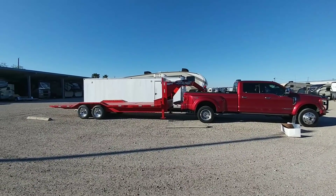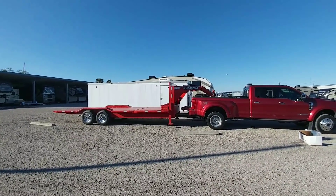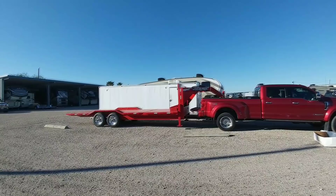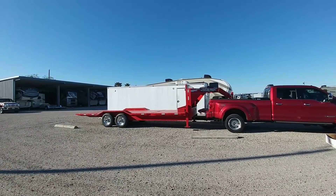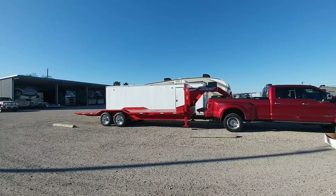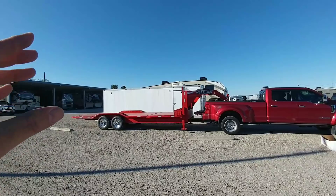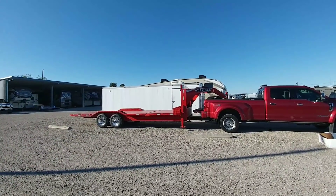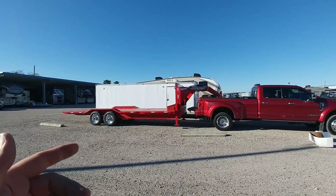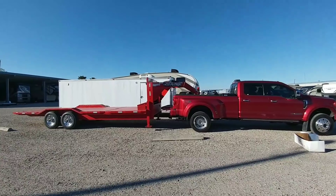We have some videos coming up, so subscribe if you haven't had a chance — we're going to be loading some pretty heavy equipment on the back of this trailer for testing. Anything above the 7,500 pound payload capacity I have for my derated trailer, we'll be doing off-road, not down the highway. The trailer was built to hold about 15,000 pounds but we derated it to about 7,000 pounds, comparable to a 12,000 pound GVWR trailer. When we load it up to 14,000–15,000 pounds for testing, we'll do it in a private environment, and it's going to be really interesting to see how the Gen Y hitch performs under those conditions.